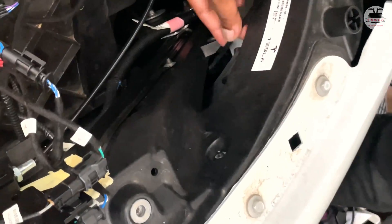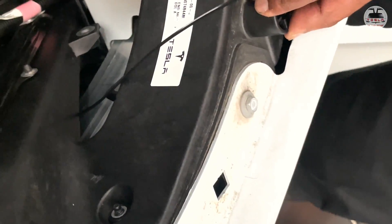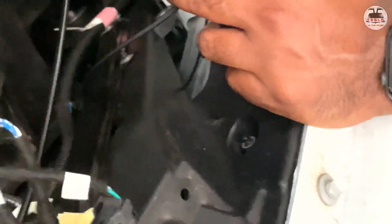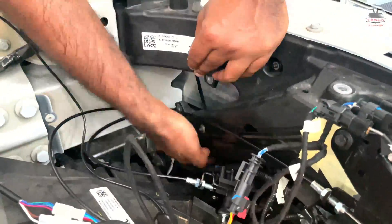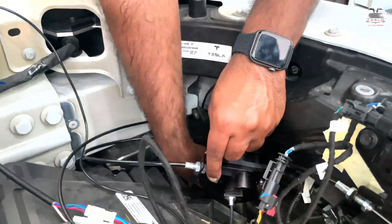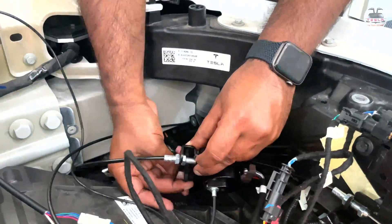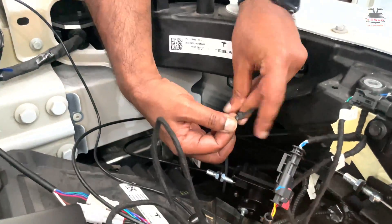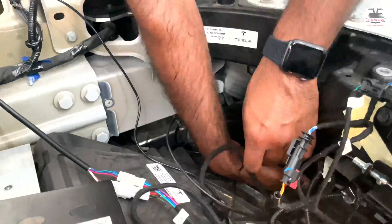Tesla offer has provided nice long cable ties. First, secure the motor in position. The controller can be secured adjacent to the battery — there's a small crevice underneath the battery beam where you can mount it using the included double-sided tape. It's also recommended to add a cable tie for extra security. Keep the controller as high as possible to avoid water ingress, although the controller is supposedly waterproof.